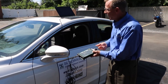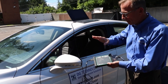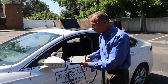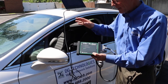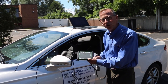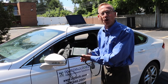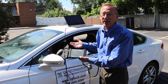It's probably best to make sure these cables are secure in the tool. As you heard earlier, we downloaded the software off the website onto the laptop. This tool powers off of the USB connector as well as the vehicle, so you'll see the green power light comes on once we plug into the laptop. Now we're ready to plug into the car — this is a 2013 Ford Fusion that has a check engine light on and seems to be running a little rough. We'll see what we can find out with our DG Diagnostics OBD2 software application that comes free with the VSI next-gen tool.